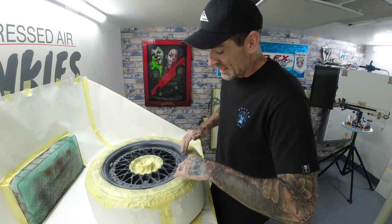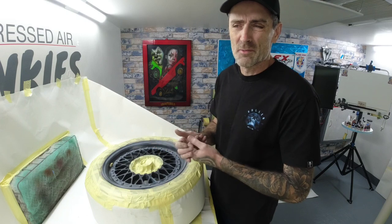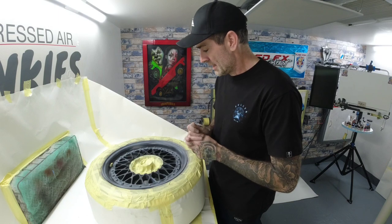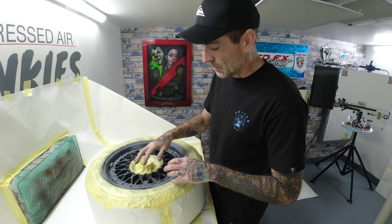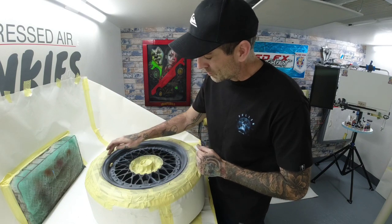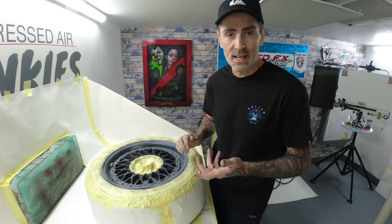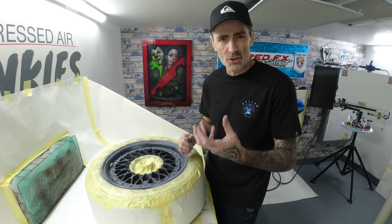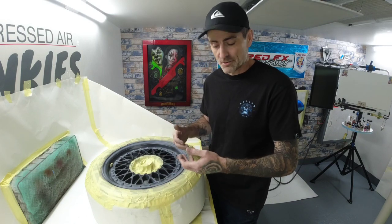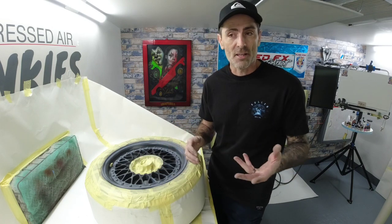I went in and scotch-brighted all this up because these are quite new alloys — I painted these a couple of years back, but they've just weathered a bit and need redoing. So I went in with the scotch-bright and just scuffed back the surface. Then where there was a little curved edge, I went in with the 180 by hand because it wasn't really chewed up — just a light graze. Knocked that back, then went down to a 320 and knocked it back with the 320.